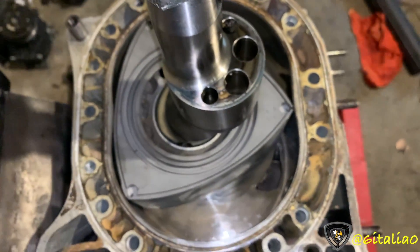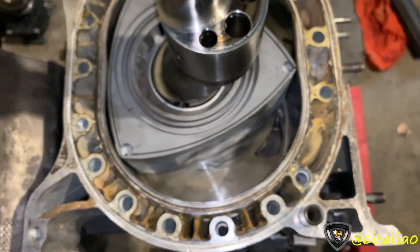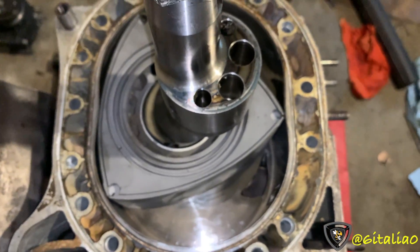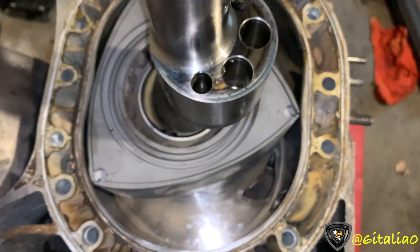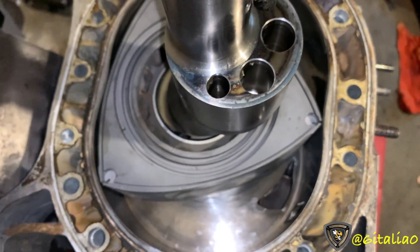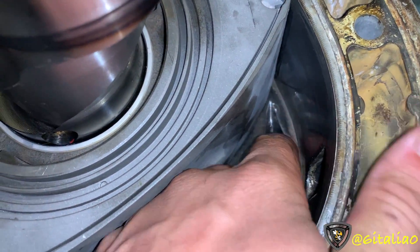It's even less reliable, you get worse fuel economy, and it's the exact same case for power — top-end gains with loss of mid-range. So the best thing you can do is leave it stock, except right here in the upper portion of the exhaust port.